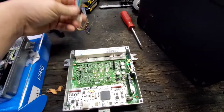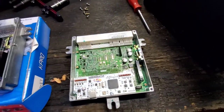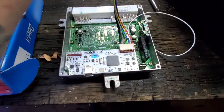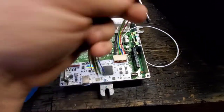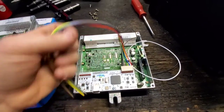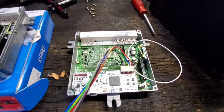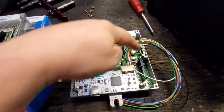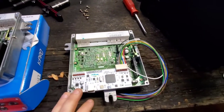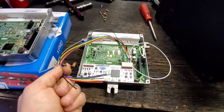I'll plug it in, get the white wire separated, and band these all up so they're not flopping around. Once you've got it plugged in, you're only going to be using this white one, which is your ethanol wire running to your sensor. All the rest of the stuff I'll put a couple of zip ties on. I'll run this white wire out through the crack right here and then run it to my sensor.